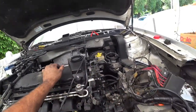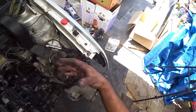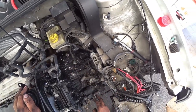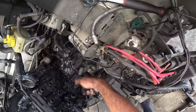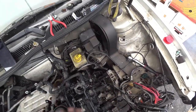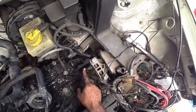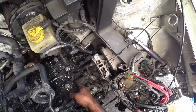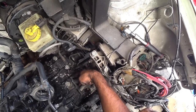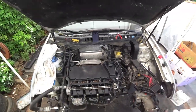We got the ignition coil — all the main wiring that was here just pulled down and out, and just move everything over to the right. We unbolted the three 13 bolts for the shifter linkage, the 13 right here, and the 13 for the ground right there. And everything again pulls right over to the right. Once you're done with that and you move everything out of the way, make sure you remove the shifter pendulum — which is a 13 as well. You're going to need to get a 13 wrench and a 13 socket down here to get rid of this brace.